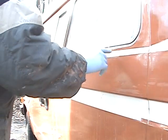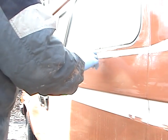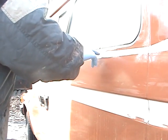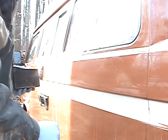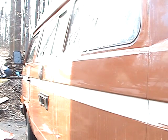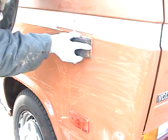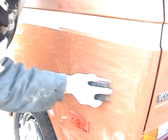After each sanding I go in and dry it off again, and I can still see where it's not completely smooth — it's kind of shiny. Still got some orange peel, so I keep doing it and drying it, making sure I never go too deep where I'm going to burn through the coat of paint. I found that the block works better in the back on these curves.